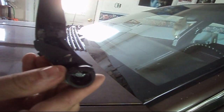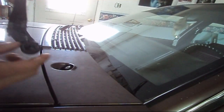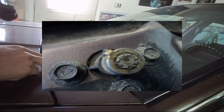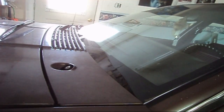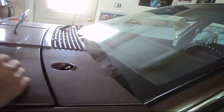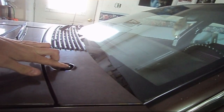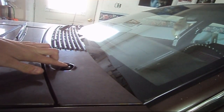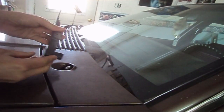Take note inside here — you'll notice that there is actually a keyway. This here is actually a safety mechanism, if you want to call it that. But this ensures that this wiper arm will never fail. Here we have the inside look of the transmission. We can see where the wiper arm actually connects to. There is also a notch here — this is where your keyway lines up.